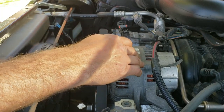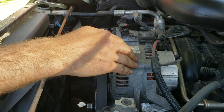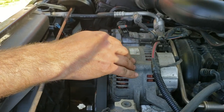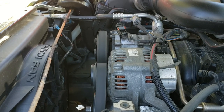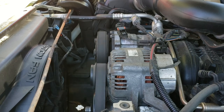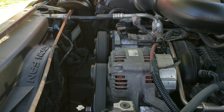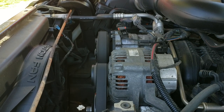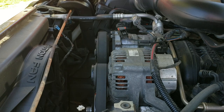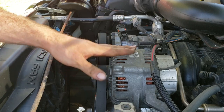I don't know if that noise is coming across on the video or not, but it is from our alternator — I can confirm that. You can kind of hear that grindy rattle. The noise does change as it runs a little bit longer, but you can hear kind of a grindy, rattley pulley, and what it is is bad bearings in this alternator.